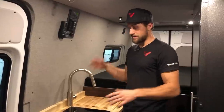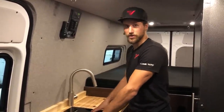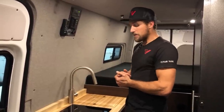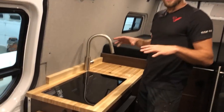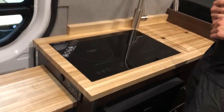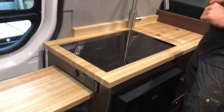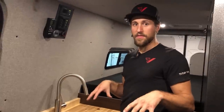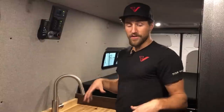You'll be able to cook good meals — roughly eight hours worth of cooking. The rig also uses an electric hot water heater and electric fridge. This entire build is essentially electric-powered off the battery. The only other appliance type is a diesel Webasto furnace. For this size of rig, we definitely recommend the Evo 40 over the 2000 ST — the Evo 40 is bigger, twice the BTUs, and for this amount of volume especially for wintertime use, the Evo 40 is the way to go.